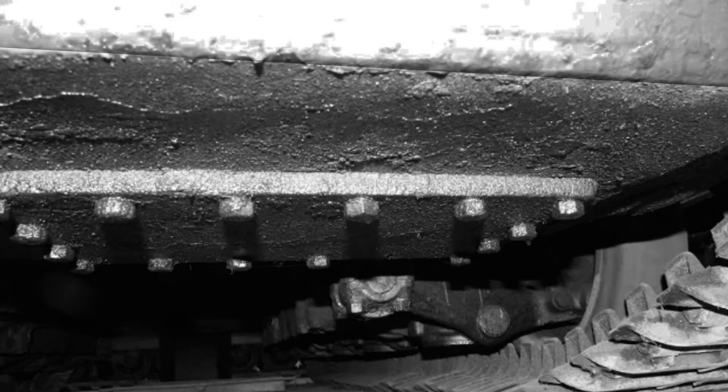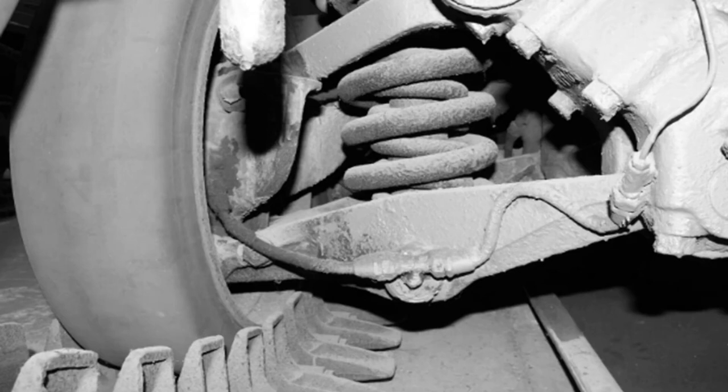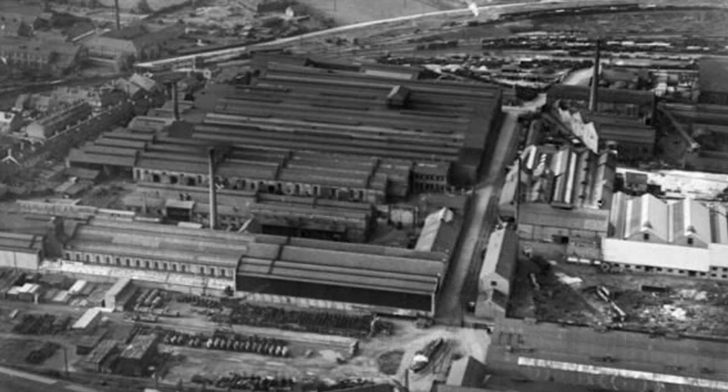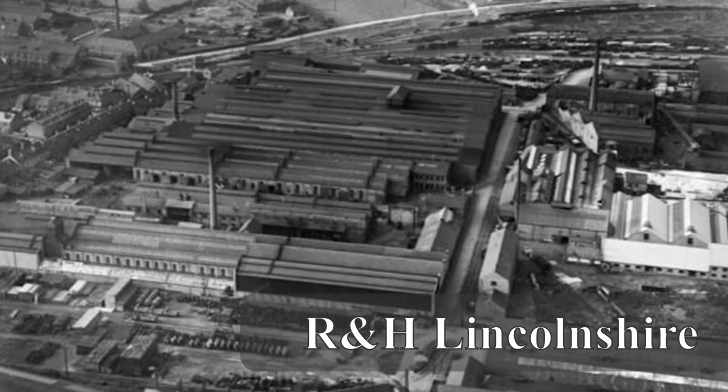While this lip is obviously a flaw, it would in all likelihood have been quite correctable in any production machine. A more impactful issue was the increased weight. The Valiant was based on the Vanguard suspension, which was rated to about 20 tons, but with the weight creeping up it began to overload the suspension, compressing the springs and losing their elasticity over time. The original ground clearance on Vanguard was 17 inches, but with the new armoured rear end it lowered to just 14 inches. Today, as the vehicle has not been regularly maintained, the suspension is down to just nine inches under the welded plate section — having taken 75 years to reach that level.